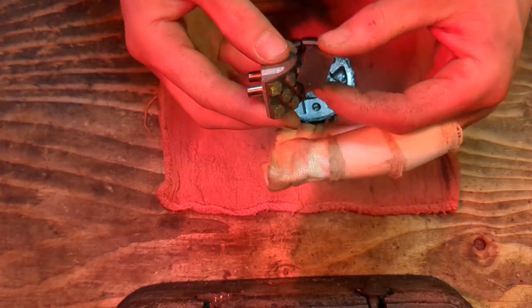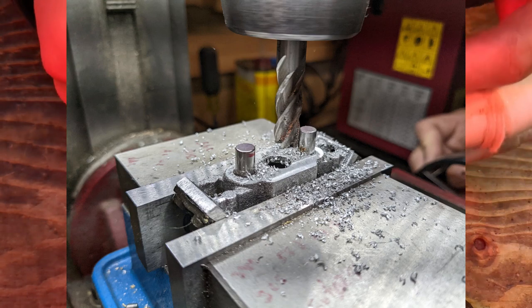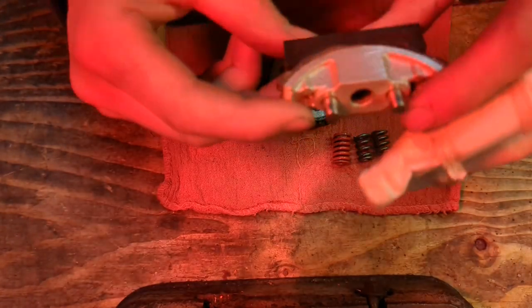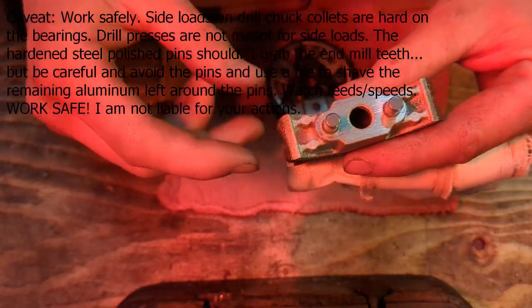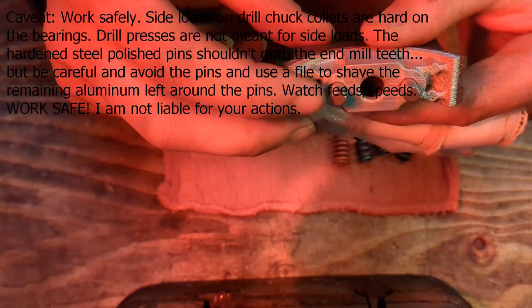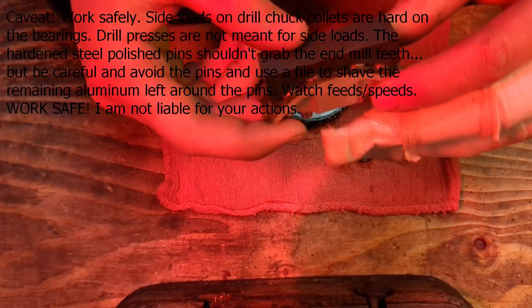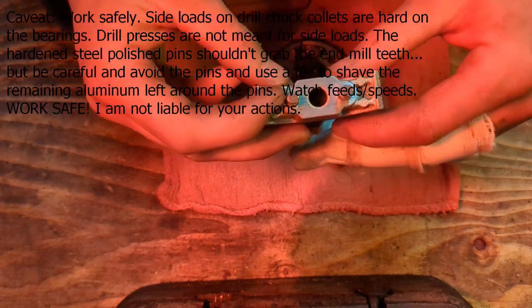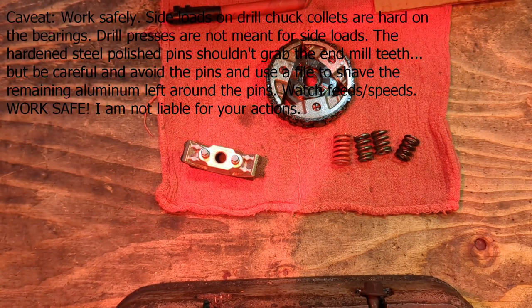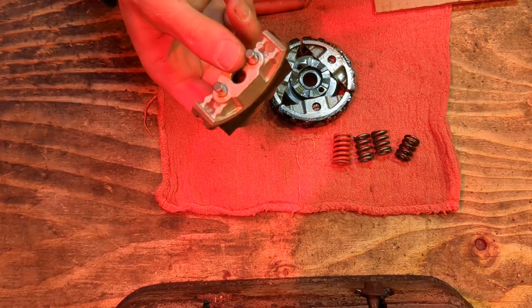And this cast aluminum is so soft. I haven't done it yet. When I did this job, I did it at a neighbor's with a little tiny three-axis manual mill. I'm willing to bet you could do this operation with a good vise in a drill press with an end mill in the chuck. As long as you don't hog into the thing with huge depths of cut, you should be able to take tiny little passes in a regular drill press with a regular drill chuck, as long as you don't go ham and try to do the whole pass all at once. If you're gentle with it, it should work. So, link to the file in the description below.